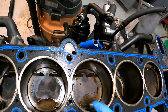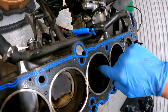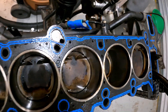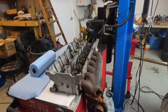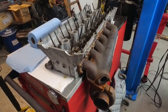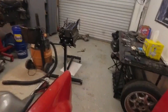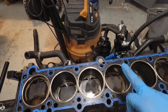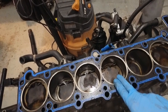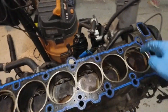On initial inspection, cylinder three — the one that's blown — doesn't look to have much damage at all. The crosshatch just looks fine. I might not even skim the head; I might just put it back on because everything was skimmed and built so recently. There wasn't any overheating, warping, or head lifting. Everything was 150 PSI — it's just the ring lands. This one let go originally and then like five events later this one let go. So now we just got to replace them, because he hurt them all when he detonated it.